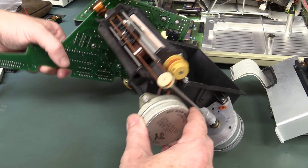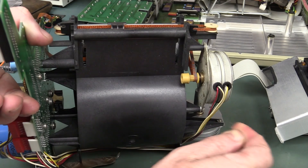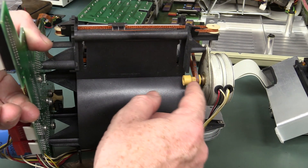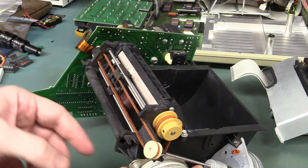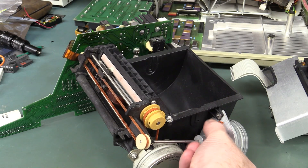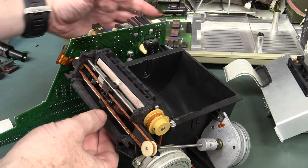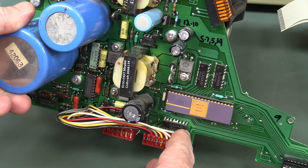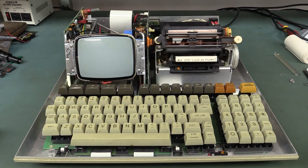There's really nothing else inside the printer we haven't seen. Just this motor — a little bit of crud, but that's about all. It's maybe a little bit of dust, but pretty darn clean. We have a motor to drive the roller, which then drives the paper. And we have the stepper motor, which drives the ceramic head across — which heats up, because it's a thermal printer of course, with thermal-sensitive paper. No extra drive circuitry — it's all controlled from here. The ribbon goes straight into the printer head. ULN2068 — a transistor driver array.